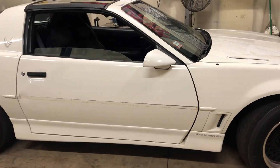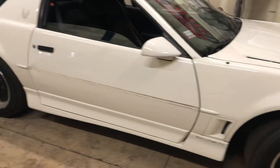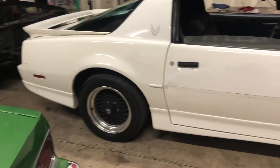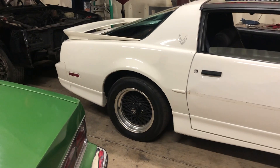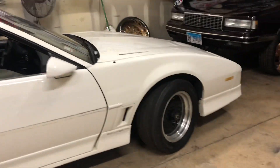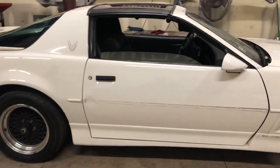We got this Firebird right here. Dude's been hitting me up for probably about five months. You can see what wheels are going on. It's going to take a couple weeks before I get into it. I'm going to order the axles because I've got to narrow it — I already measured all that out. Narrowing it three inches, both sides and the back. Do a little fab work to the tubs — just a couple little things in the way. Had the wheel on there; wheel sticks out two inches, so narrow it three inches, trim the lip a little bit on top and the wheel will be on. Front alignment is completely out of whack — I'll take care of that. But this is going to be a couple weeks; other cars get done before this one.